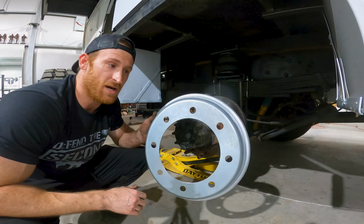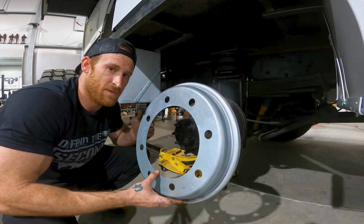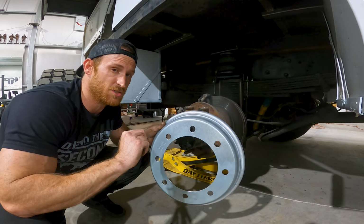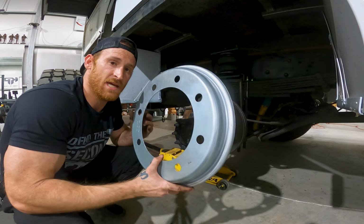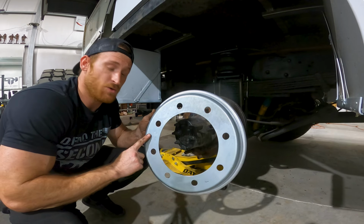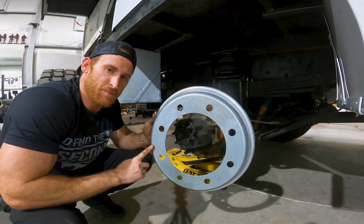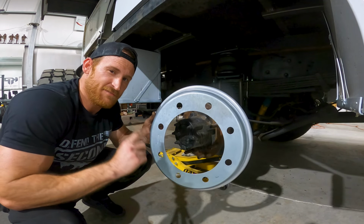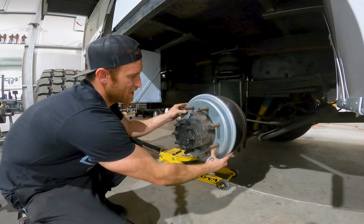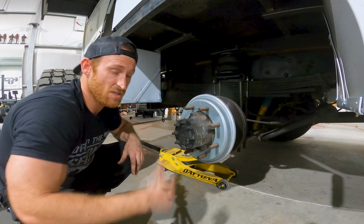Okay, now in the rear, I'm actually running the same Centramatic balancer as the front, and the reason is because I'm running super singles. So I'll link the part number to these down in the description below if you run super singles, and I'll put the rear part number to the dually setup if you wanted to order those. So just like the front, it slides right over the hub, and then you install the wheel like normal.